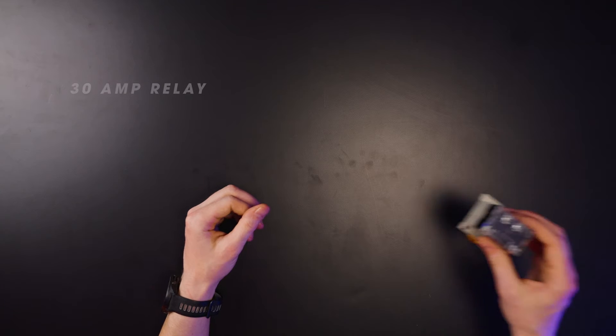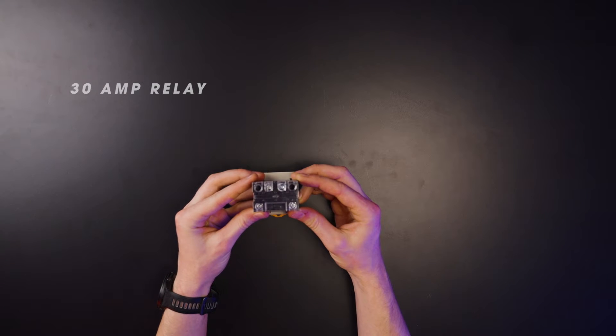One output is dedicated to a front light bar or lighting array at the front of your vehicle. We've allocated a 30-amp relay for this, because it's not uncommon to run several individual lights or a large-capacity light bar. This relay is DIN-compatible, so it snaps onto your DIN rail with the rest of your Garmin connections, and it's triggered by a simple output on the Garmin Kinect 50.